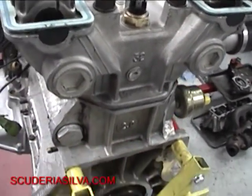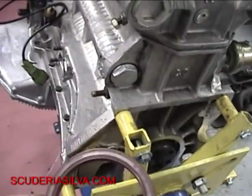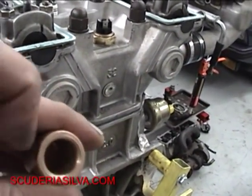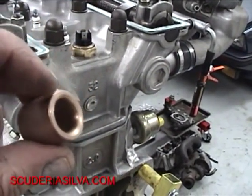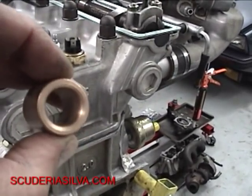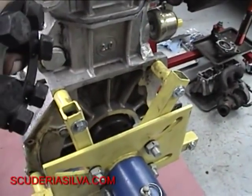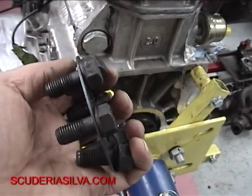Other than that, we're going to throw the rear main seal in — take it off the engine stand, throw in the rear main seal. I'm going to change the bushing — once again Paul Sproul Racing in Georgia has the tapered input shaft bushing that goes in the back of the crankshaft, so when you offer up the transmission it slides right in the hole. Then we're going to use our flywheel bolts with red Loctite on those babies and this lock plate, and we're done.